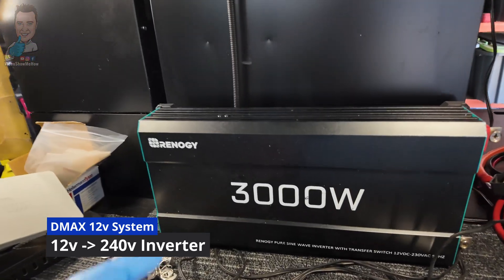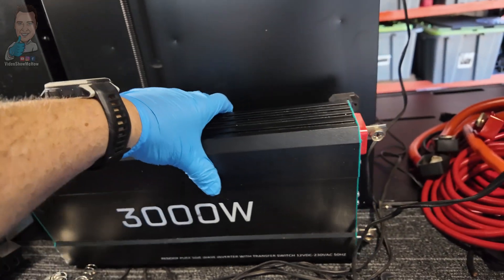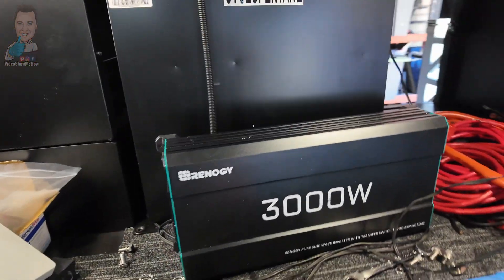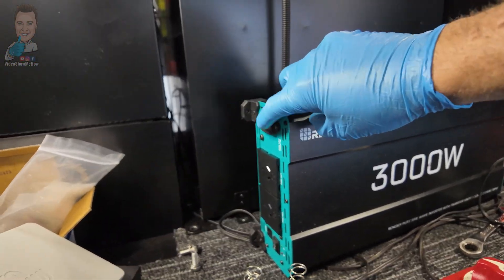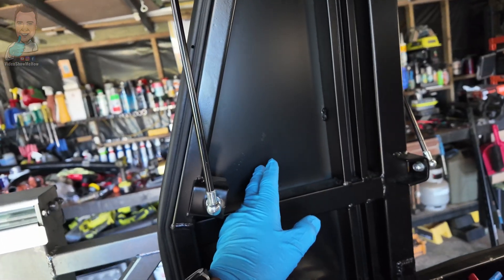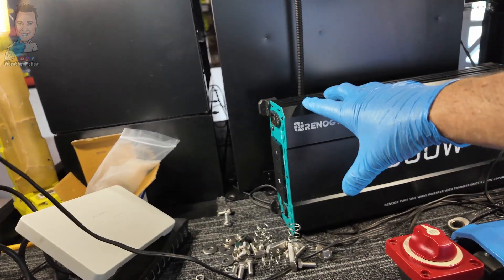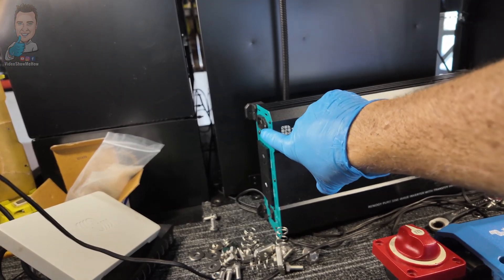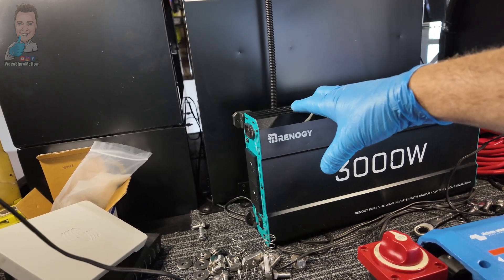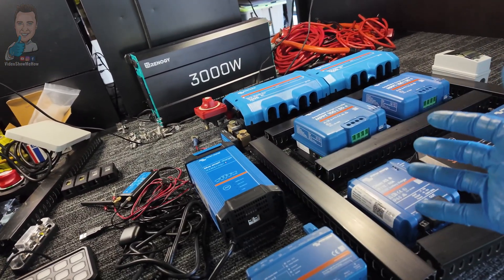Finally, from an AC perspective, we'll be recycling our Renogy 3000-watt inverter. This thing has been awesome — we've been using it for a few years now, still going strong, has big active cooling, good for up to 3000 watts with some pretty big peaks, and also has pass-through power, which is really important. We'll have an exterior plug that you can plug the D-Max into — it'll run our charger but also enable pass-through power, meaning you can run everything in the system automatically off 240 volts without touching the battery. So if you're plugged in at a caravan park, you get shore power and also charge the battery.